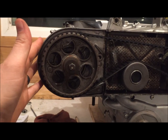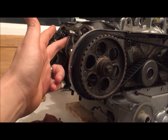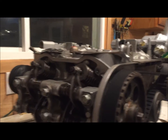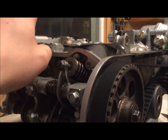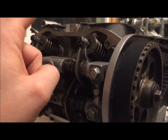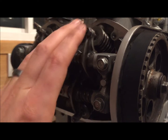When you go to adjust the valves, you're not necessarily going to have the front covers off — you can just remove your valve cover and make your adjustment to your tappets. The book tells you to make sure you're on top dead center for number one, then rotate the crank to that position. We also want to make sure we're on the compression stroke, not the exhaust stroke. On the compression stroke, both the intake and exhaust valve rockers will move because both valves are fully closed at this point.